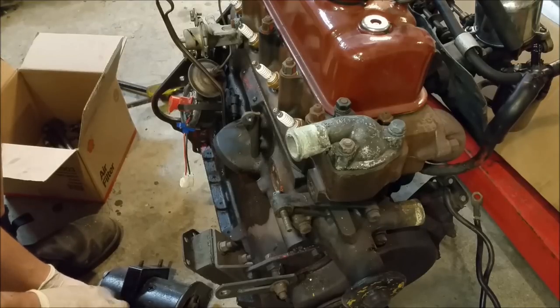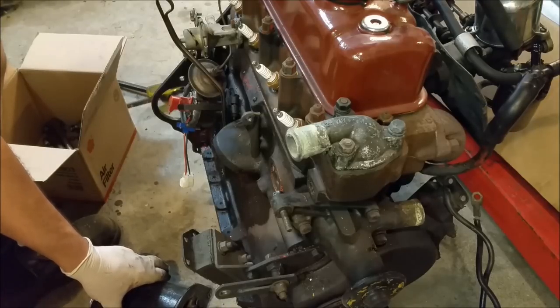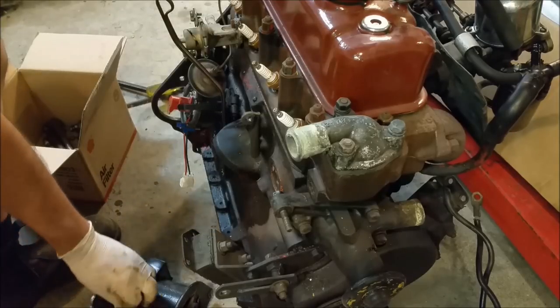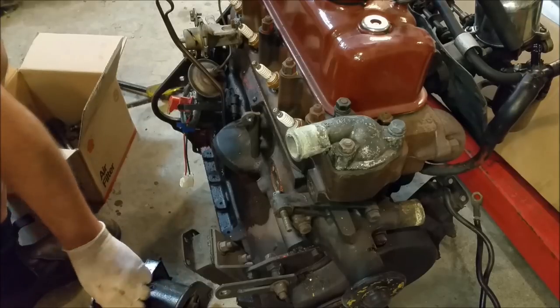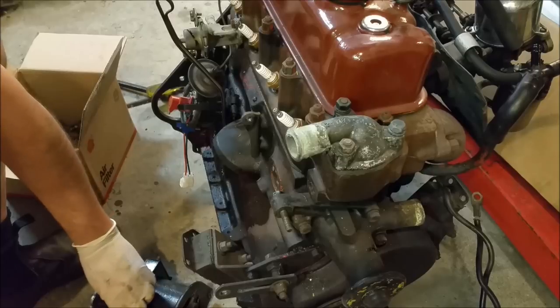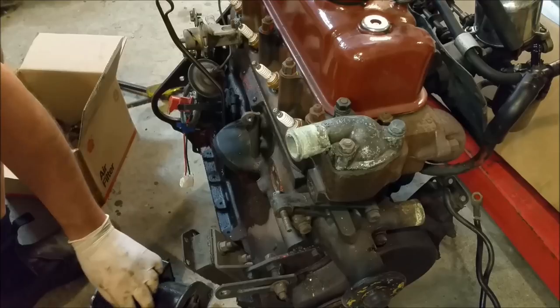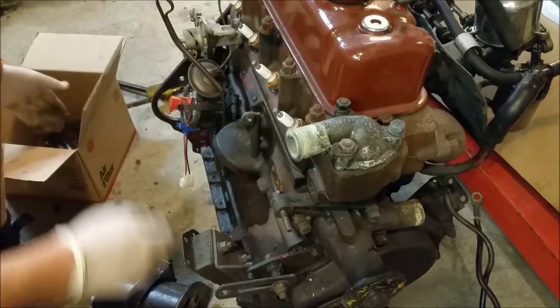Welch plugs or core plugs in this thing look really good. So I'm sort of hoping I don't have to do much at all to it. The flywheel worries me because apparently one of the ring gears isn't available. I've got to figure out which one it is and take it from there.